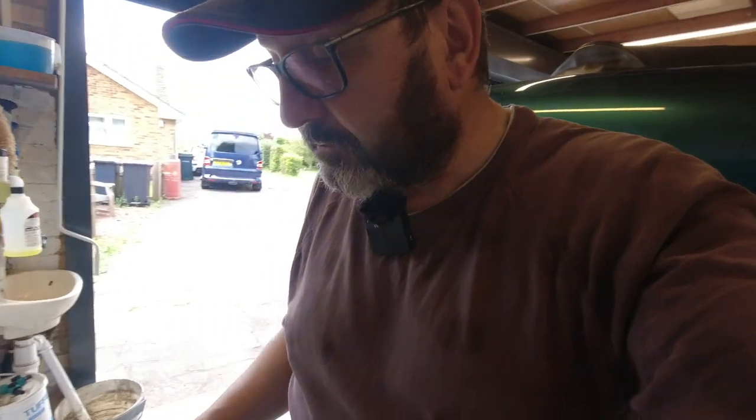Now I'm going to drop the car down. For many of you it won't be a case of dropping the car down. What we're going to do now is start her up and just run through the gears to open various valves, then let the engine warm until the transmission gets to around 30 to 40 degrees C. We've just filled the sump of the gearbox and once the engine's running it's going to pump oil through the filter, around the gearbox, and fill up the torque converter. Once that's all filled up we'll have the true level in the pan, so we've got to top it up with the engine running.